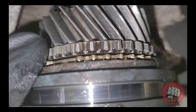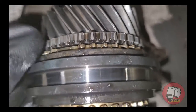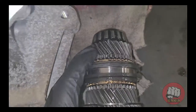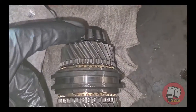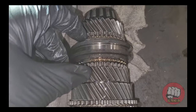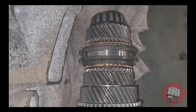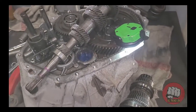So yeah, that's what I found guys. The cause of the grumbling is the bearing, and the popping out of gear or grinding of second gear is due to the faulty synchro. This will need a new bearing, a new second gear, and a new synchro to solve this problem — or obviously a recon box. Thank you for watching and I'll see you at the next one. Until then, peace.